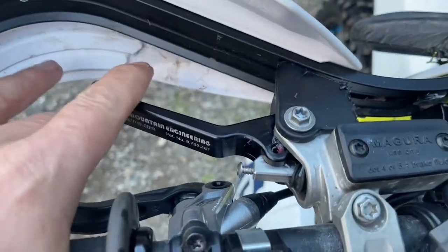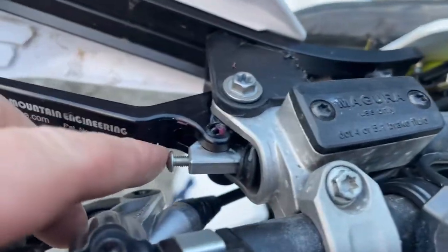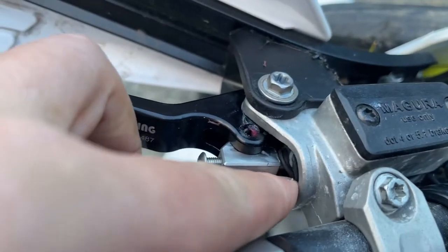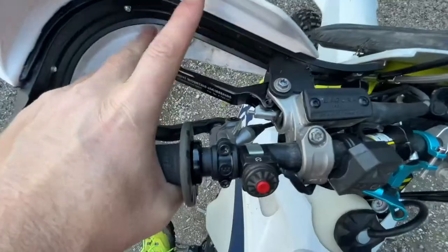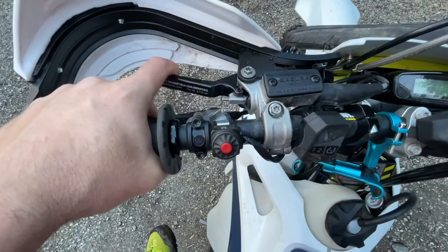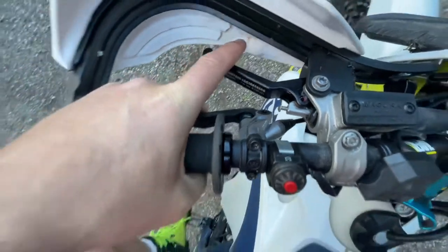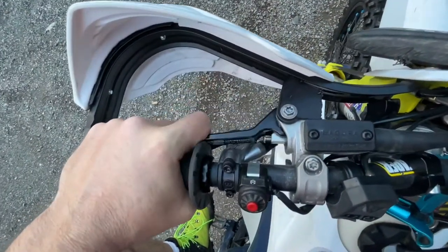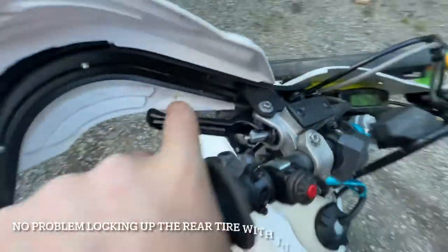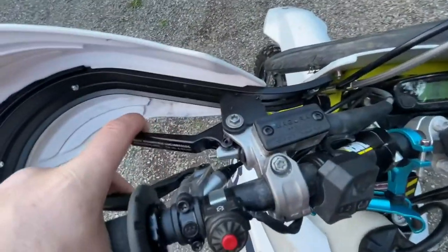You've got to adjust it so it's fully engaged and fully disengaged. There's a stop — there's a screw in there to adjust the length. I adjusted this so I have full leverage out here to go one-finger clutch, all day. And then the second finger on the brake — I can like lock it up. I just did a mountain trail run practicing clutch and brake. You angle this apart, get the right distance, and you want to angle it so when you pull, your fingers don't pinch.